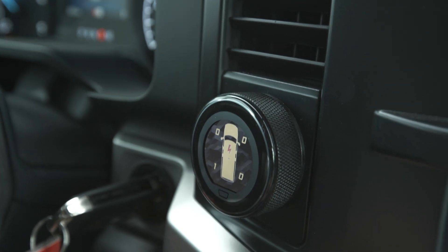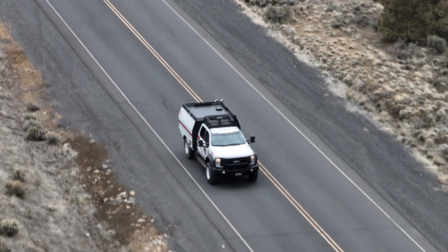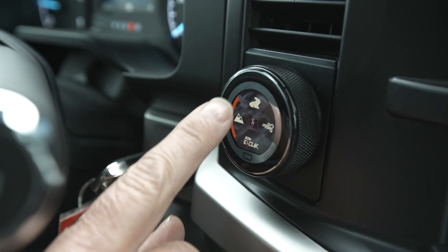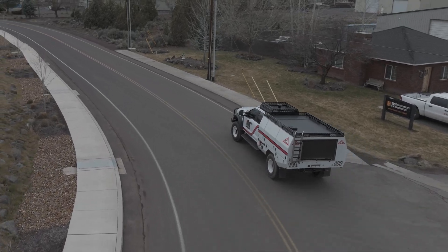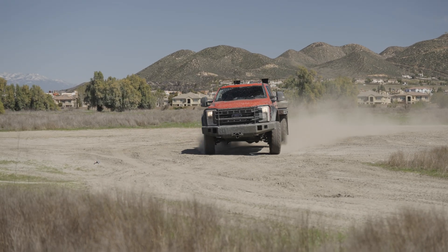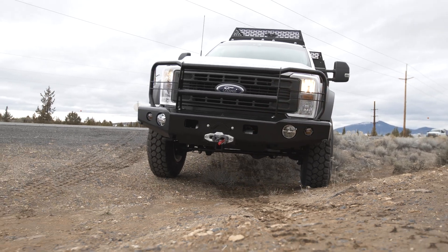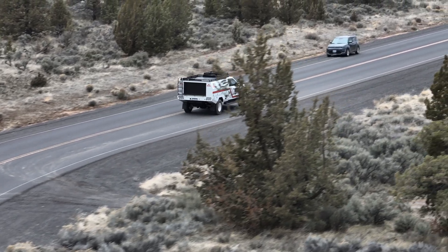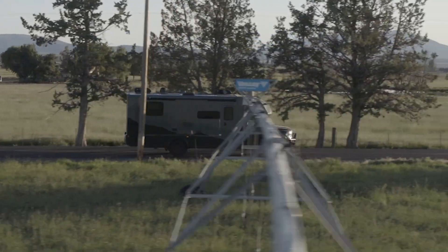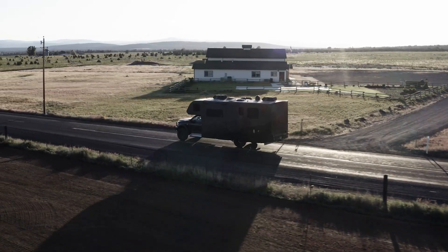You'll find similar systems in high-end road vehicles, even for Raptor trucks. The system offers three modes: highway, off-road, and wind — each pulling up different algorithms written for the driving experience. Off-road allows flexibility so the axles can walk over large bumps. On-road mode provides stability at speed. Wind mode is for tall vehicles, with the algorithm increasing sensitivity to side-to-side action.